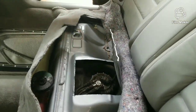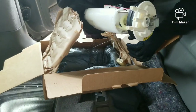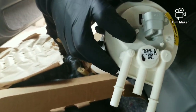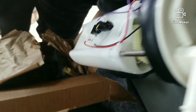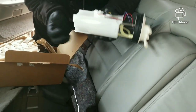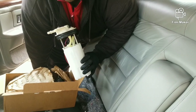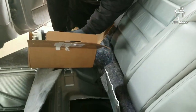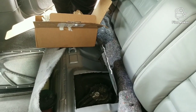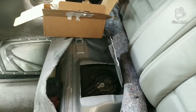I went with Delphi on this pump here - this is an OEM manufacturer for a lot of GM Delco stuff. The part number is FG0010-02. This is the updated design and it's supposed to be a lot better. On the factory one there's a strainer on the outside, but on these new ones the strainer is inside the pump, so it's a much better design. I was able to get this through Herco Automotive - they're based out of Florida and had a special on these - got it for about 40 bucks.